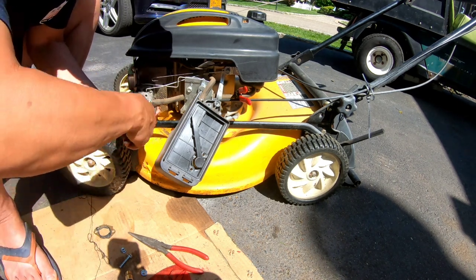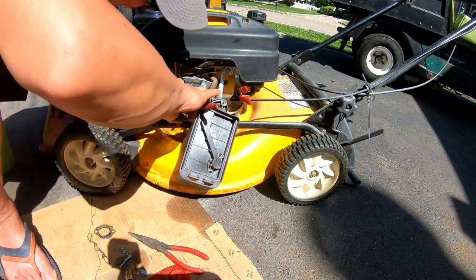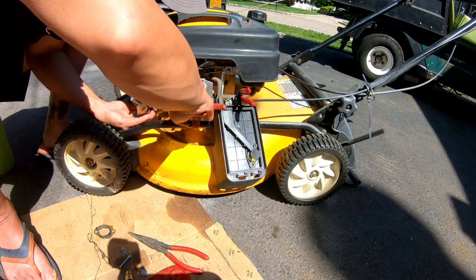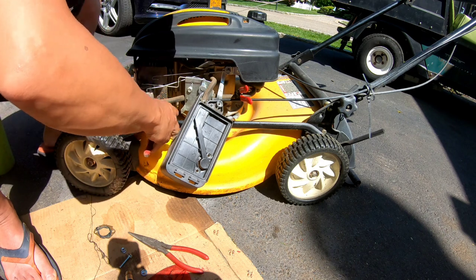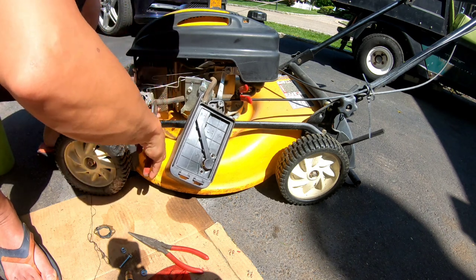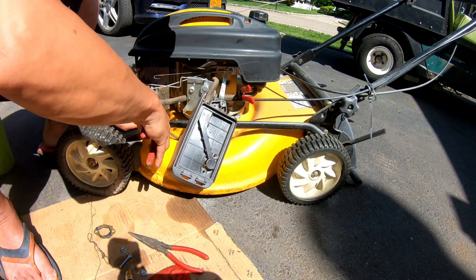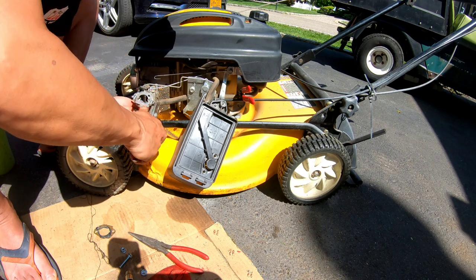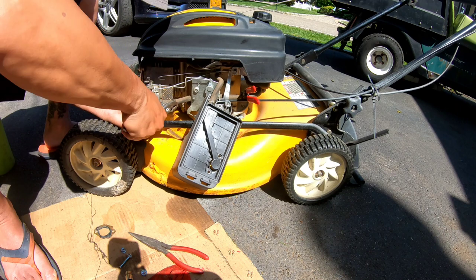See, this is not a quick and dirty. I mean, look, it does run, but on choke, which is not really supposed to be like that, you know? You're supposed to be able to take it off choke and it runs smooth, which means that there's still something dirty in the carburetor that a quick and dirty probably can't get, you know? And this clamp just is not releasing.